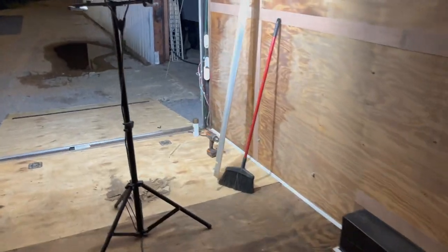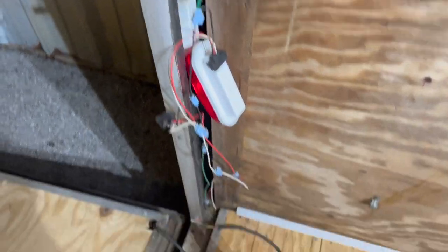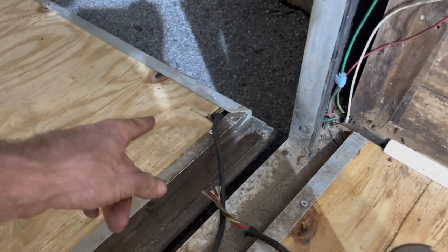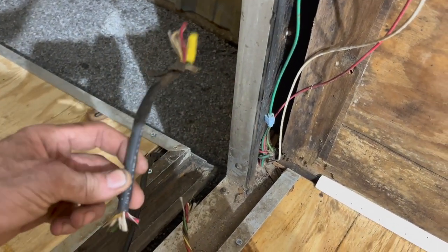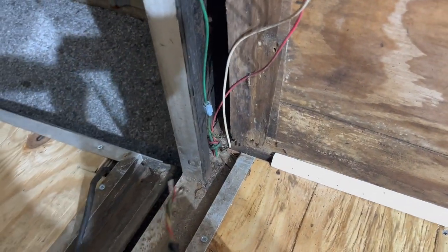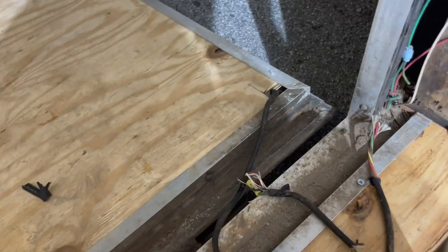Lights are fixed. I figured out there was a short to ground on the running lights by disconnecting wires in the junction box. The only wires that didn't look good were this loom going to the tag light in the door — that's how they had it connected. I cut that wire and everything worked. All I have to do now is shorten it a little bit, rewire the tag light, and we're good to go. Running lights, running lights, running lights — all the lights work.